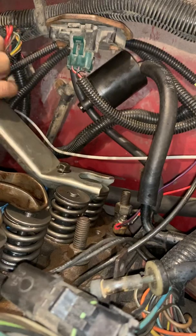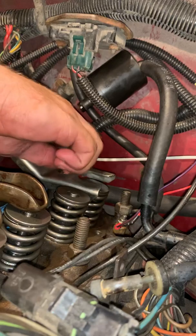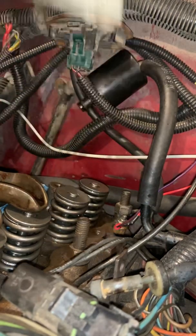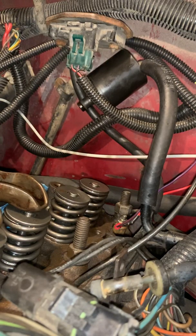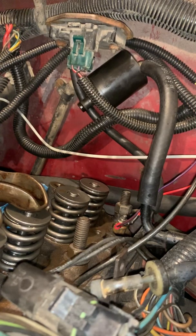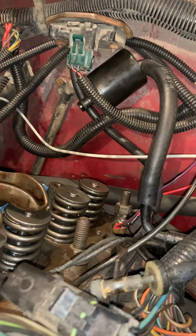Both keepers in, ready to go. Unscrew our tool. Perfect. Now at this point, I'm going to go ahead and disconnect the air because I don't need it anymore. So you're going to hear a big old whoosh of air coming from that cylinder, okay? And there we go. And look at that. Everything is in place, and now we're not going to have the air compressor making noise and ticking me off.